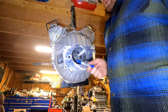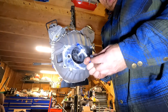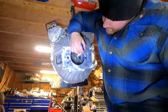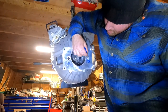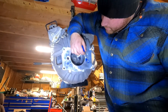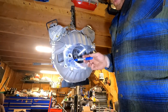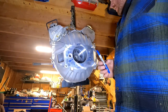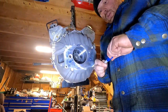We can't do two completely separate things independently, but we can — we're going to aim the elliptical part of the dowel. So if the dowel looks like this and this is the perfect circle part, I'm going to aim the part that sticks out in the direction I want to go — which is a little down and a lot sideways. So we're going to loosen up the bellhousing bolts, knock the old dowels out, and put the new offset ones in.